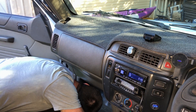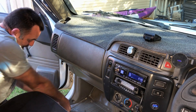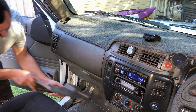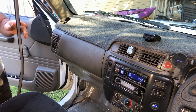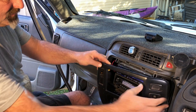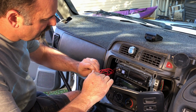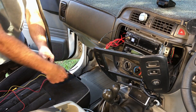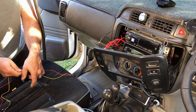Because I'm hardwiring this, I'm going to need to remove the kick panel. I've chosen to go down the passenger side because I've already got a lot of gear going down the driver's side with my EGT gauges, boost gauges, GPS power, and that sort of thing. So we're removing the kick panel and the trim around there, and then finally pulling the door seal off — you can see I've already got a cable running up there. I'm going to tape this up with black electrical tape in a couple of sections to make it easier to run.